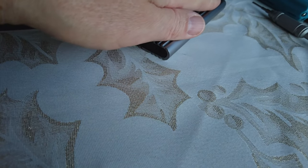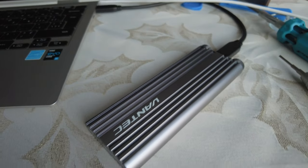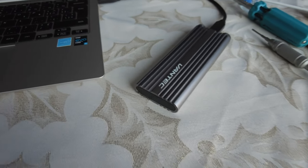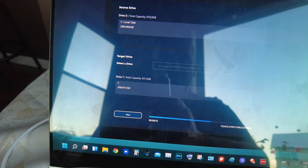Let's hope. Hi again. As a matter of fact, I'm pretty sure I introduced cooking instead of working conditions. Let's see this. Now it's warm to touch, but this is completely in its protective and cooling casing. Look at the speed, over 201 megabytes a second, and it's working really good. So I introduced throttling due to overheating, so I cooked it on the first attempt. I hope I didn't kill it too much from the longevity point of view, because look at it now, 202, 34%, and 915 gigabytes free again from the beginning, but now it runs much faster and much cooler.